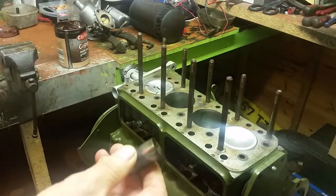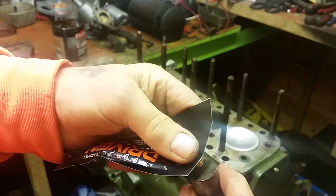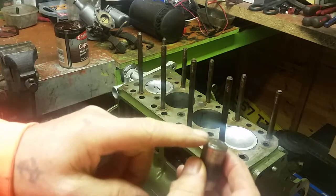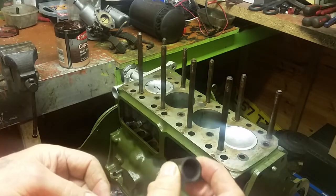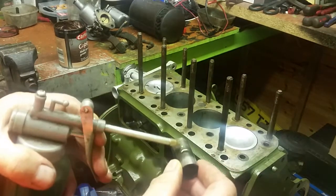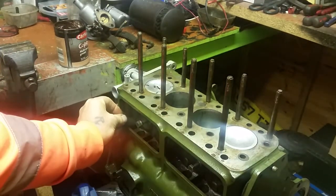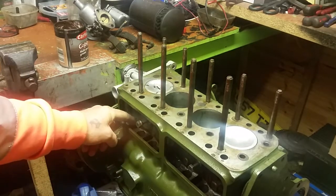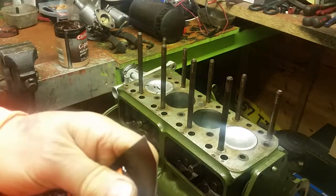Right, we'll start with the very basics. Get yourself a bit of assembly lube and put a little drop on the bottom of your cam follower, because that'll just help lubricate the cam until the oil gets circulating. Give it a little dab of oil with your oil can, then just drop it into the recess in the block. They'll be at different levels, because the cam is in a different position each time.